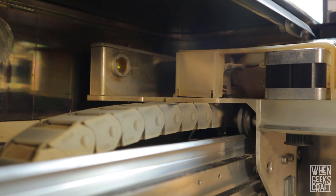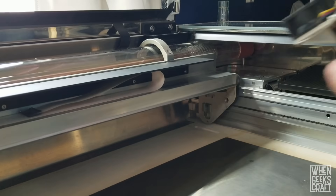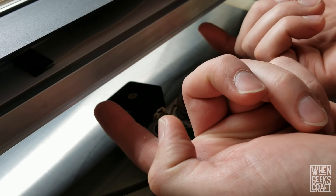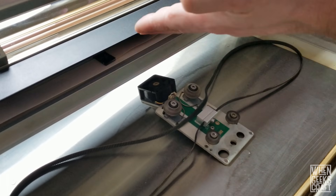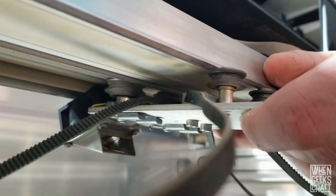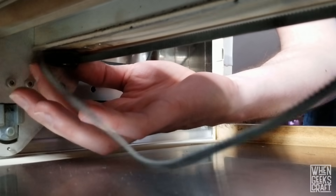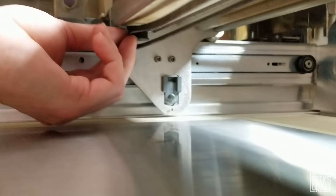There's one other mirror in here to clean off - ours has been cleaned recently - that's that one. So we've got to get the gantry back on. The important part is that the teeth face the teeth. Because the back wheels are the spring-loaded ones, we've got to start there first - hook those on, pull forwards against the springs so that the front wheels have enough room to clear, and then it's all just going to kind of suck up. You kind of want to feel where it is - there's an outer lip here and I can feel where the lip is on the back. It feels connected, so I just pull up and now we're on.